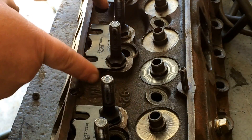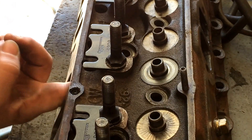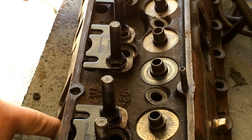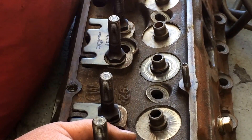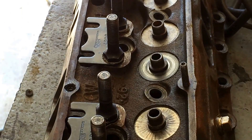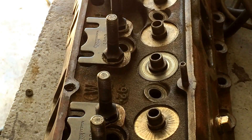I'll spray powder because you've got weak spots in here — these have been ported for better air flow and more horsepower. They get weak if you take too much out of them. I don't think that's the problem with these, but it's always a good idea to check. That's how you magna-flux a cast iron head. On aluminum, you don't really do it like this — you have two or three different ways to do it. You can pressure test it.